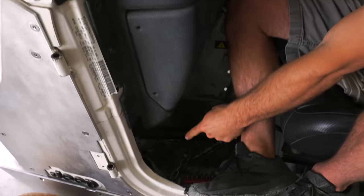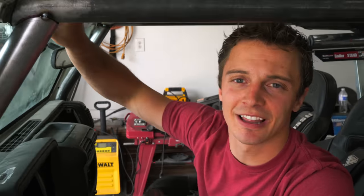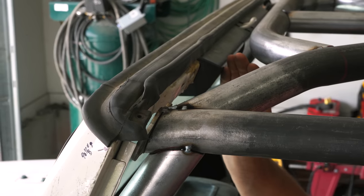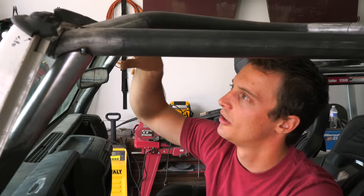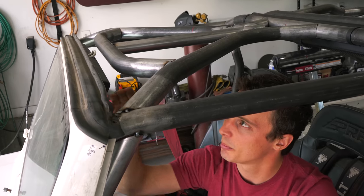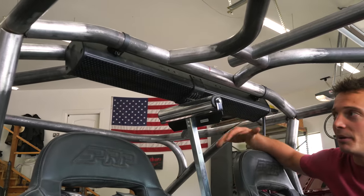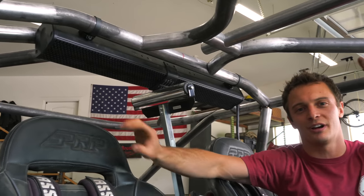There were three things that were really important to me on this cage. First, this A pillar goes all the way down to the floor and bolts to the floor while going through the dash and all the ducting — that was really tough to get through there and miss everything. The second thing was these latches on the windshield. Jeep put them in a terrible location for a full roll cage. When you've got a straight bar across here, you can't take your top on and off with these latches. So I came up with a design to be able to swivel that latch all the way up and miss this by about a quarter of an inch. The third thing was getting the sound bar up behind me but above my head so I could reach the on/off button and not have any vision problems looking through the rear-view mirror.